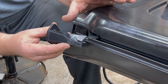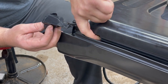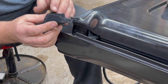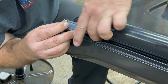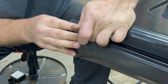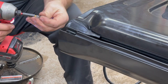We've reached the final step — installing the corner seals. We've already done the passenger side; now we're doing the driver's side on camera. These are notoriously difficult to install: you need to get the rubber lip under the metal lip of the tailgate while sliding it in and making sure the rubber seal rides the edge of the tailgate. If you install it and it's tucked down, you can use a tool to pull the rubber seal out without fully removing it. Got the seal on the outside, caught on the inside. Now put the Phillips screw into the pre-drilled hole in the tailgate.